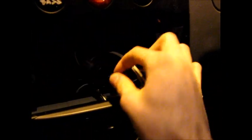You don't have to do that, you can just run it directly to the speaker if you want it to be on all the time. But if you want to do an interrupter, I actually recommend putting the switch onto this remote line here. Yeah, this blue one. The blue wire from the Bazooka, it's very important that you connect that. I was having a big issue with it before.